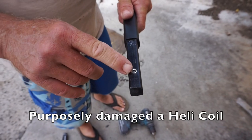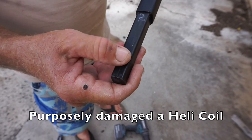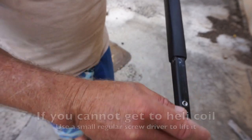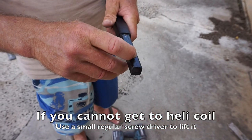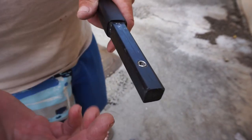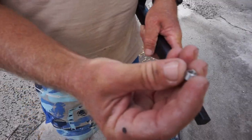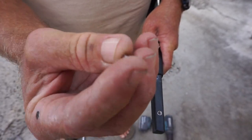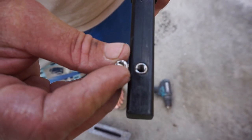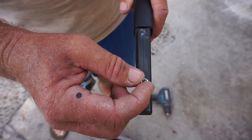I finally forced my helicoil to go all the way through from the top side through the fuselage — now it's sticking out the bottom. This is not good because it's going to be in the way of your wing when your wing goes on. This is basically a spring: there's threads on the outside and threads on the inside. The inside is for your bolt; the outside is the threads where it goes into the fuselage. Let me grab one so you can see it — this is what the actual helicoil looks like. There's a tang on the bottom. We're going to put this in from the other side and knock this tang off, and this is going to make brand new threads inside.